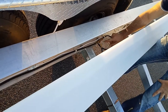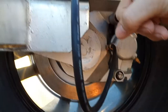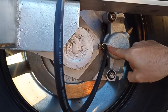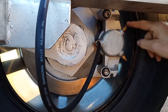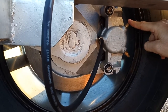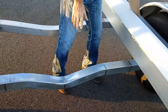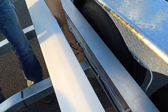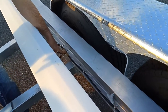Down to the second axle, there's another tee piece, and at the rear of the tee piece you'll have a tail again going to your caliper. You'll see your small line going to your caliper — it goes into one end of the caliper, and you'll have two bleeders. You'll generally use the top bleeder when bleeding the brake system. From that tee piece, you then run your line across your rear axle all the way to the other side of your rail.